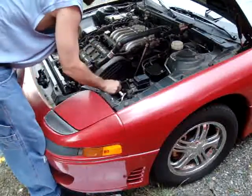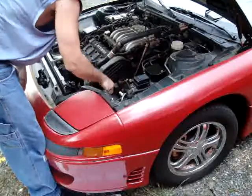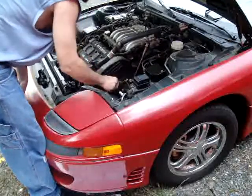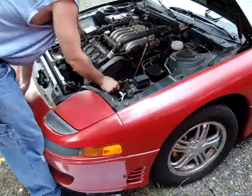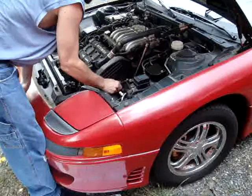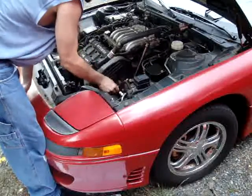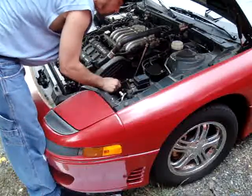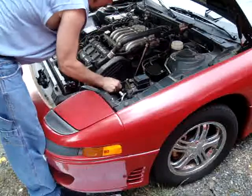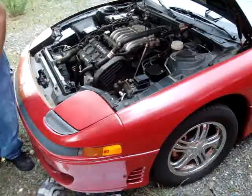This one is the time-consuming one. It's really long. There are a lot of threads to work. And if you undo the motor mount and jack up the motor a little, not using the oil pan, it'll definitely make it easier to get to, because of course, I have the air conditioning in here, and it looks like the little Freon pipes or whatever are in the way. They keep you from really sticking a socket in unless you've got some kind of super short socket.